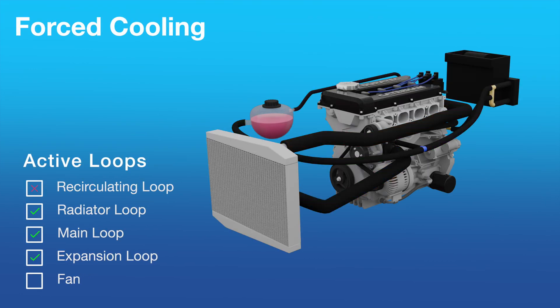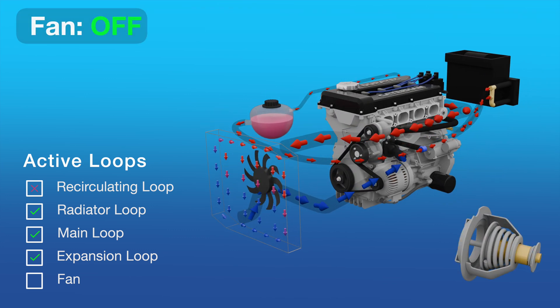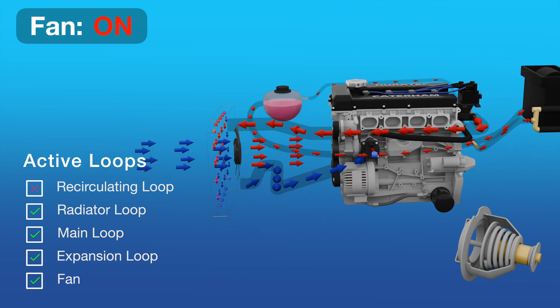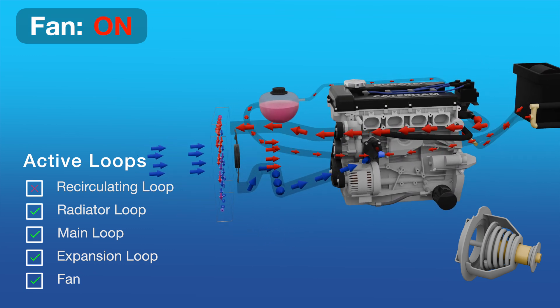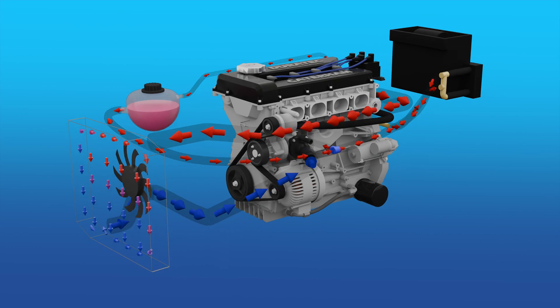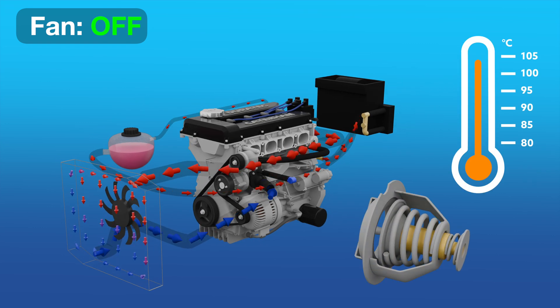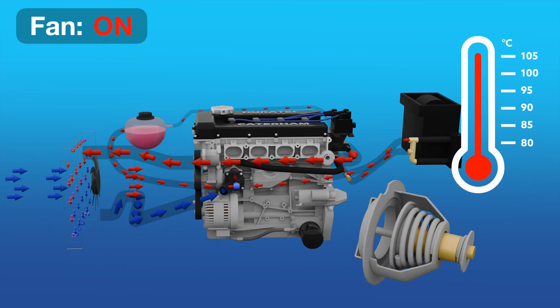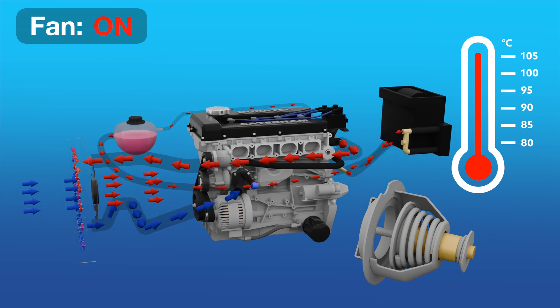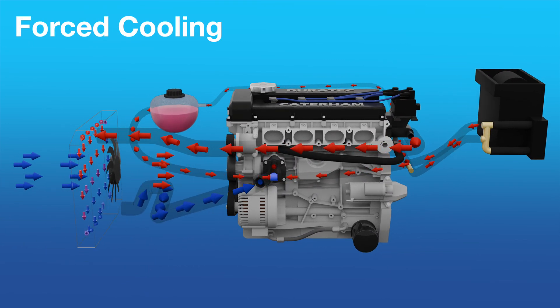Finally, there's what I'm calling a forced cooling mode. This is when the coolant temperatures get to where the thermostat has opened fully and the ECU's only option for keeping temperatures in check is to turn on the fan, which, if everything is working properly, should mean only at low vehicle speeds. The cooling system is designed with thermostat, pipes, pump and radiator able to dissipate all the heat the engine can produce, even on a track. On a standard Duratec 7, the fan is set to come on at around 105 degrees C, when the thermostat just hits its maximum extension. So this would normally only need to happen at traffic lights around town or coming into the pits after a track session.